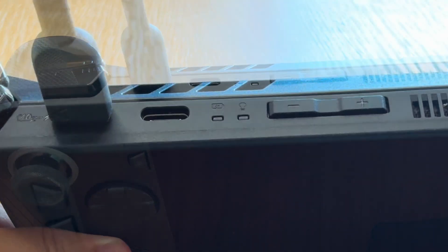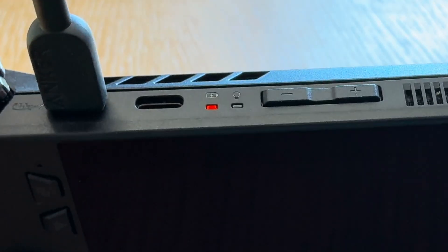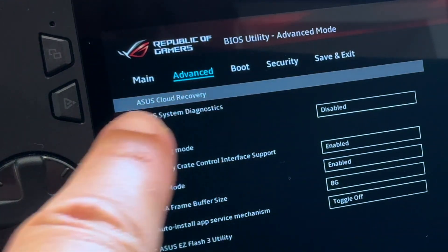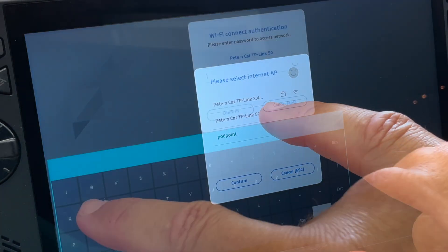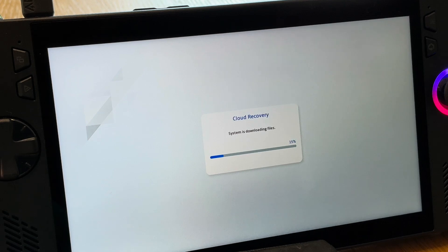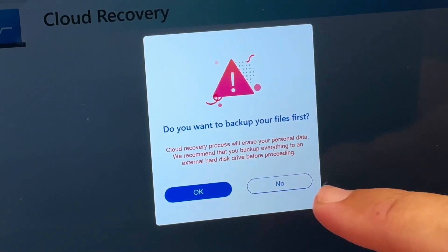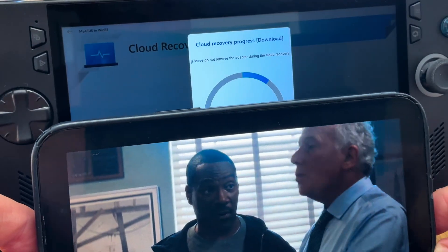Let's plug in our Ally and wait until the orange light pops up. There's a sensor in the Ally that very cleverly recognizes when we've gone inside the device. After a few minutes we're into the BIOS. Press the Y button to bring up the advanced section, then on the D-pad scroll across one to the Asus Cloud Recovery option. Press A and we simply go through all the steps to reinstall Windows and also the ROG software like Drivers and ArmourCrate. We can just use the touchscreen for all of the prompts. It may take a while to download depending on our internet speeds, and we do need to keep an eye on it for some prompts.